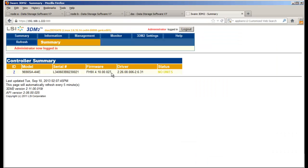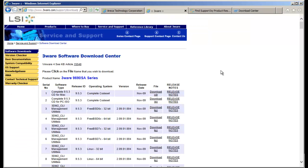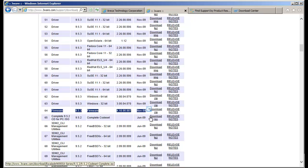Now we're logged in and can see the firmware version to identify what's installed and what needs updating. Let's go to the 3Ware site. I found it a little difficult because even though LSI purchased 3Ware, I couldn't find the 9690 on LSI's site, so I had to go to the 3Ware site. It's a bit confusing — you have to scroll all the way down to find the firmware. The latest version for this release is 4.10.00.007, available as a zip file to download and unpack.